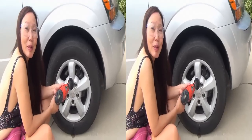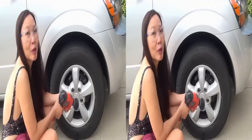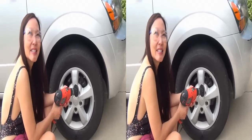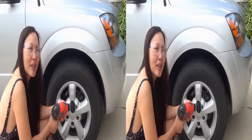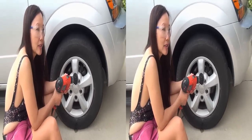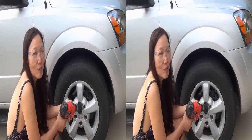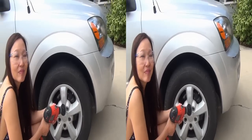But we're showing you things to do and not to do. Remember, when we were talking about this wheel — the 400 grit — you think 400 is very fine. Well, it goes up to 3,000, but 400 is strong enough to knock out your paint as well as the clear coat. They also said it's not meant to take out scratches. It will with a heavier hand, but the challenge with a lot of people is that they focus on getting the scratch out. And then they realize all the other stuff they've done. We happen to have everything that we need to go ahead and repair it. We can take this and make it like it was brand new after we've used the 3M product as it is not meant to be done, so that we can restore the wheel.